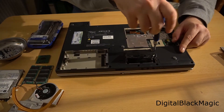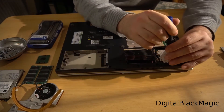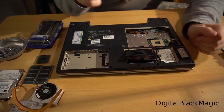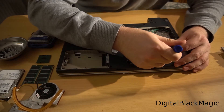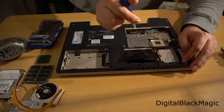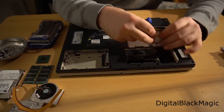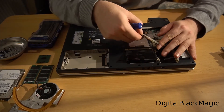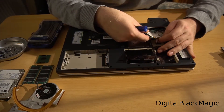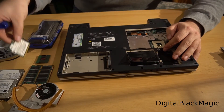This lid contains another component of the computer — the wireless adapter. The wireless adapter sits in a socket similar to the RAM modules but bigger. It says 'Intel Wireless' on this add-in card, and it has wired connections, which are of course the receiving antennas. I'll put the card next to the other components we just removed from the computer.